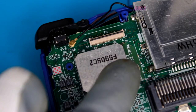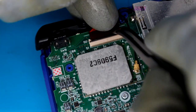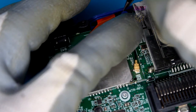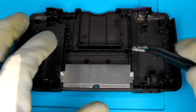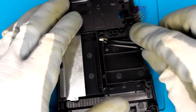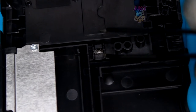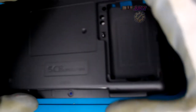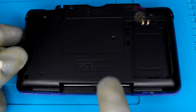For the left-hand side, put the cable in and the antenna cable. With the antenna cable, pop it around this pillar - there's a little place for it, push it down. Before putting the bottom on, get this little tiny nut and put it into the plastic hole - it requires a bit of force, the lip has to be over that edge. Then put the bottom shell piece on and put the six tri-wing screws into the shell.